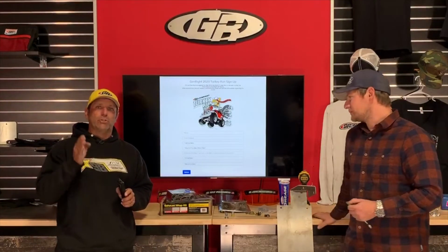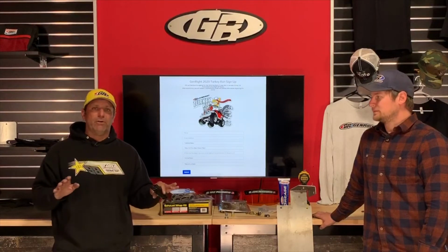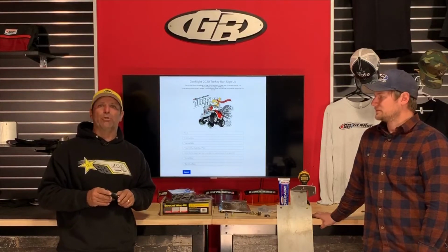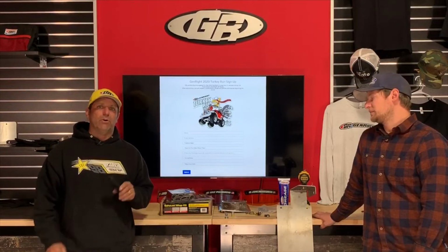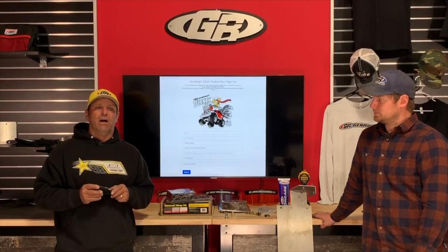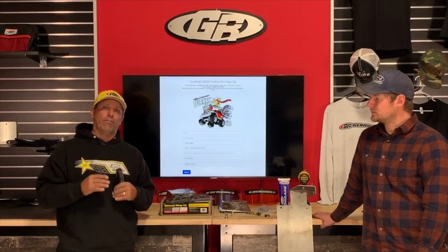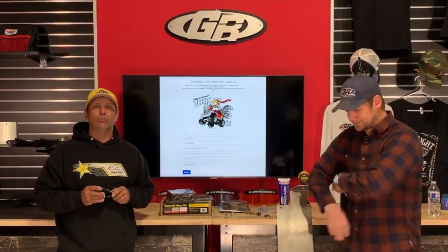Don't get me wrong, the 2.0 in a high quality King or Fox shock is so much better than the other garbage that's on the market. If you're talking about just the regular, mass produced ones, a lot of them are just made at Monroe and slapped on another sticker. Those shocks can be okay, but if you're driving a stock Rubicon, which by the way has an upgraded shock over a standard Jeep, the Rubicon ones are gas charged, which helps keep the oil from foaming, but still that is a tiny shock. That's the equivalent of a screen door closer on your Jeep.